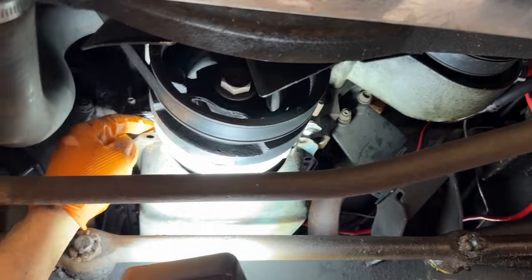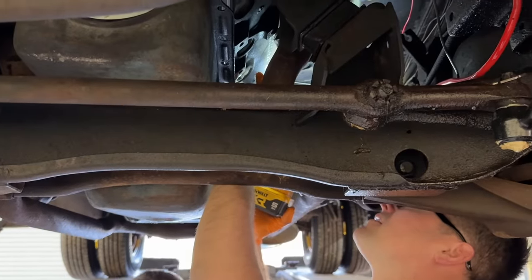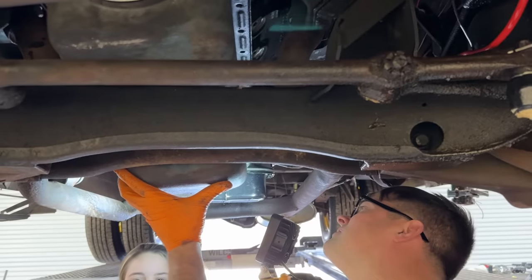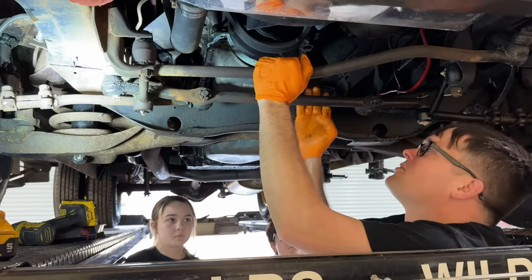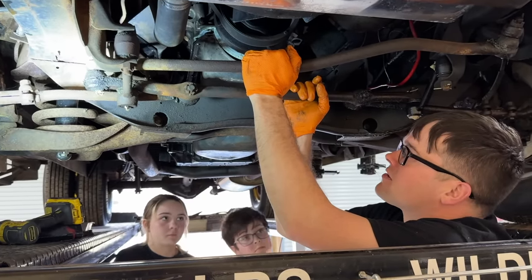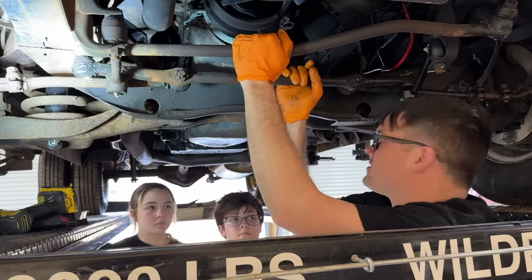You can see I RTV'd at the corners. It looks like I RTV'd around the front. The weird thing is the gasket looks fine. I don't get it. This one's just fought us. Yes, it has. Well, I guess there's no need to delay the inevitable any longer. It looks like I'm going to have to drop the front crossmember, which means unbolting the engine and all the front suspension out of this thing.